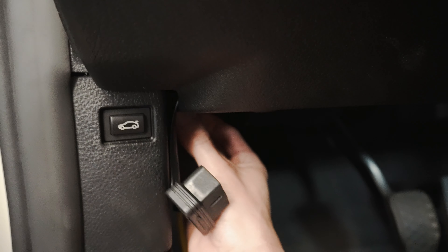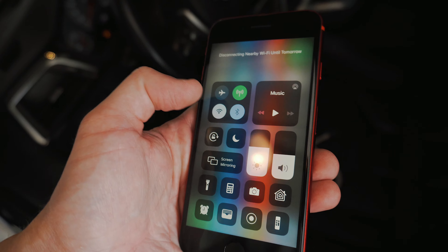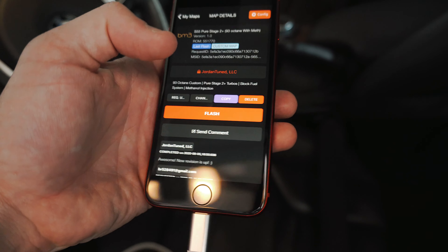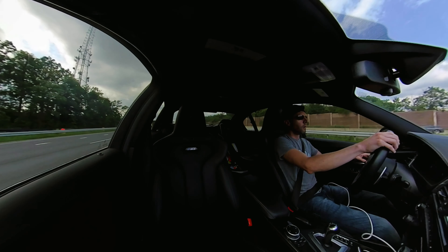Get some space here, take these wires, gently tuck them in, make sure nothing gets caught or pinched. That goes in there, this guy goes in here. Same old thing — seat belt, ignition, turn Wi-Fi off, Bluetooth off, LTE only. Hey F-mean F80, what's up? Go down to the last one — it's ready to flash. Awesome, new revision is up. Code clearing — there we go, success! All right, new map is uploaded. I went in to make sure all my personal settings are still saved and they carried over. Quick level check on the meth — looks like I'm good, about halfway, a little bit more than halfway. Now I'm just gonna put the action cam on the windshield and we're gonna go do some data logging.